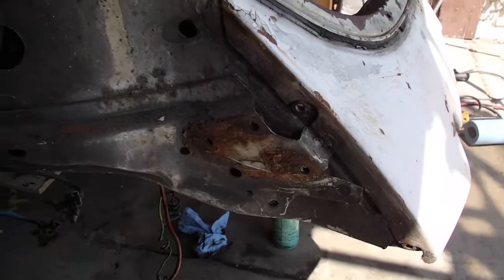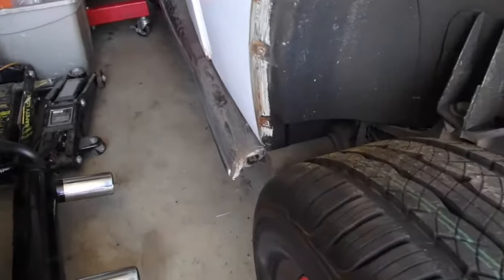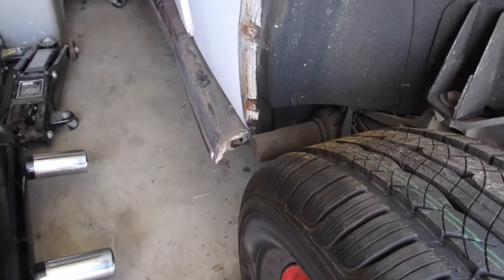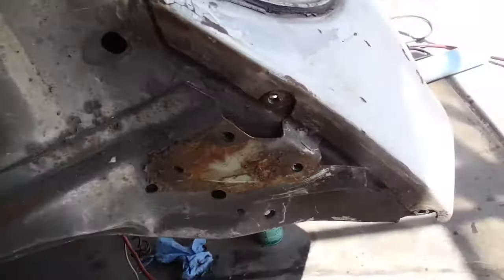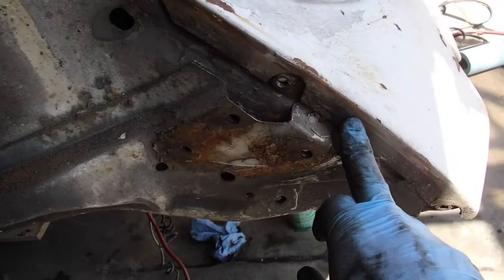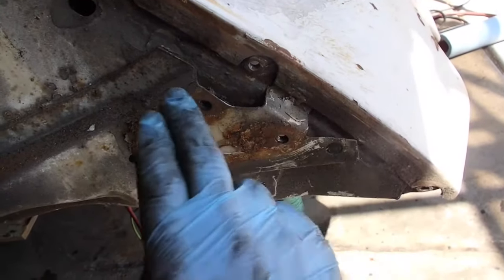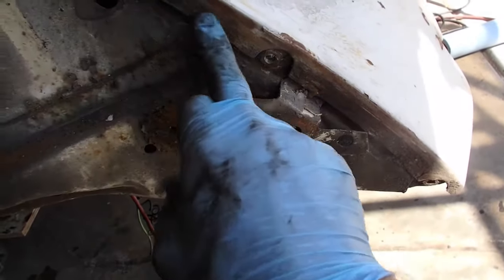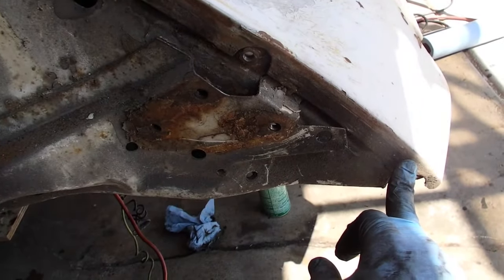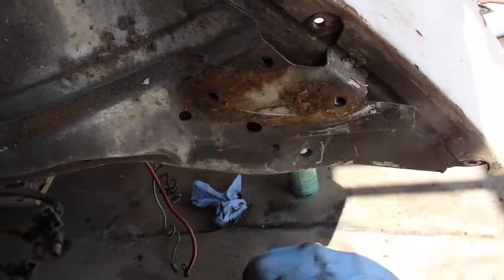All right, step one is removing the fender. A lot of bolts. So you can see there's one down there in the rocker thing. Whole bunch going up. And the reason is we need to be able to get access here. What I want to do is drill holes into the apron, not the body, to get the spot welds gone. So I'm going to be going at it from this side pretty substantially, and hopefully this obviously is going to give me better access.